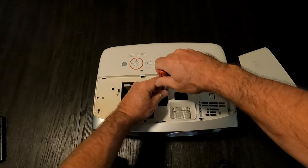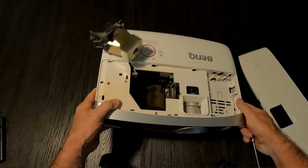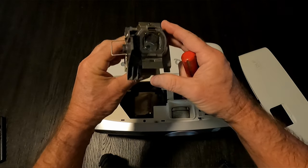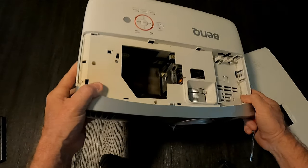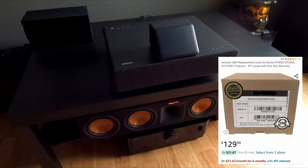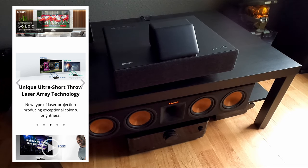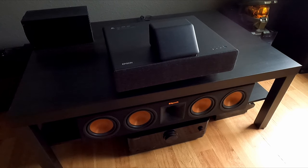Just a word about bulbs: should you get a projector where you can replace the bulbs, or one like this where you can't? You might think you should get one with replaceable bulbs because you could just keep replacing them and it's cheaper than replacing the projector — but that's not exactly true. You might get to the fourth bulb like I did, and that's $1,200 in bulbs, and then have to throw the projector away anyway. I went down the aftermarket bulb road too, and the longest I ever made it was 900 hours. I gave up on that. The other issue is that bulbs degrade rather quickly — right around 2,000 hours they start to dim. These laser projectors are supposed to degrade much slower, so I guess time will tell on that.